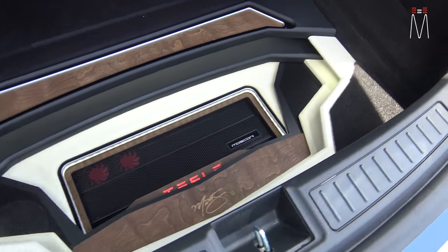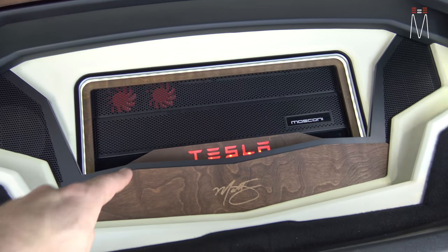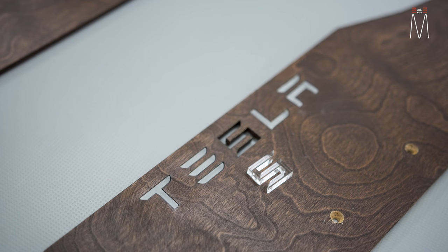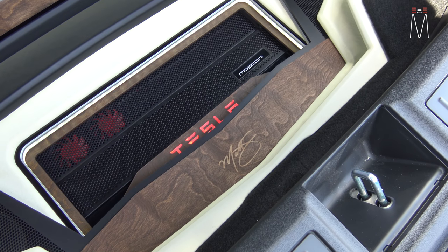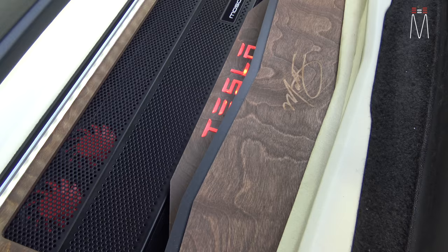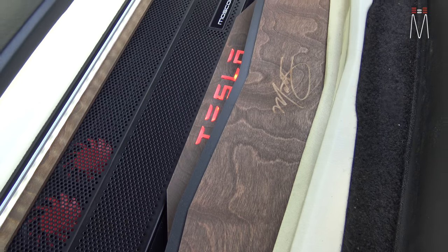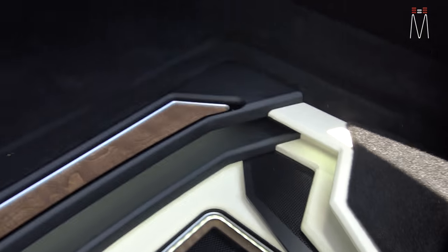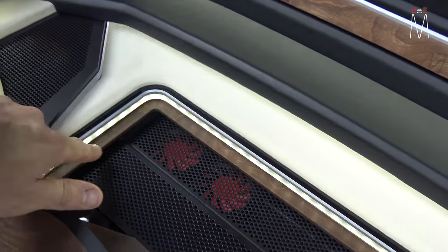It's kind of hard to see a lot of the lighting because of the direct sunlight beaming into the trunk. We did the same Tesla logo all the way at the back — individual pieces of acrylic lasered out of the birch to create those openings. I cut the same-size emblems out of three-eighths acrylic so they extrude through the birch a little bit to give it added depth and dimension, then backlit it with red lighting to make it different from all the white lighting you see.